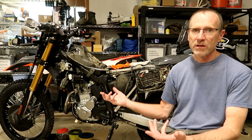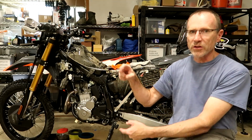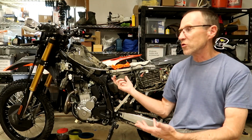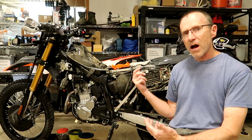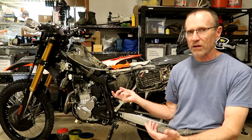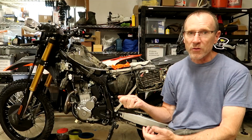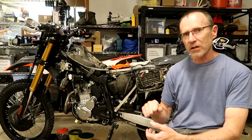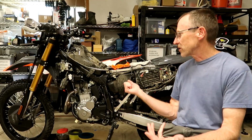It did flame out exactly where I had expected it to once I kind of got through the road a little bit. So there was a little bit of an incline, about probably a foot to a foot and a half high. And of course the bike struggled to maneuver up that little incline with no throttle input, and it died. But once I got past that little hilly point, I manipulated the throttle very carefully and gave it just a little bit of input here and there, closed it, opened it, closed it, opened it, did that a bunch of times. And I was really amazed.